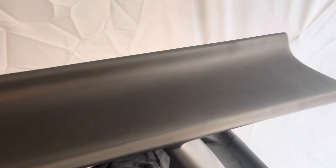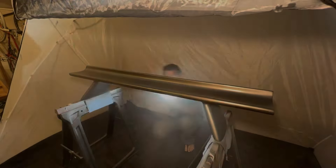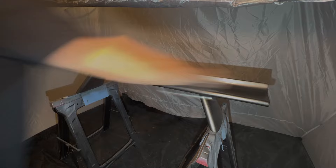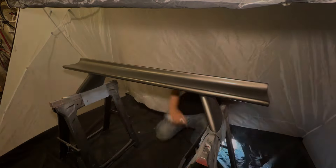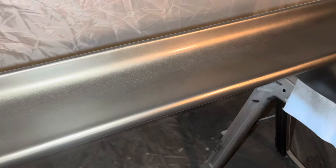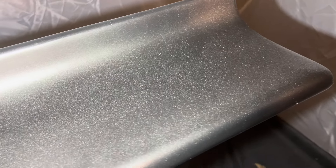Let's see if we can get a perfect match — I got it on Amazon and it's supposedly the same color as the Mustang. Word of caution: especially with metallic paint, be prepared to use a lot more paint than you originally thought. I actually had to use over two cans of this stuff just to do the spoiler and get enough coats on it. Metallic definitely is harder to apply — I used almost an entire can just for the spoiler.